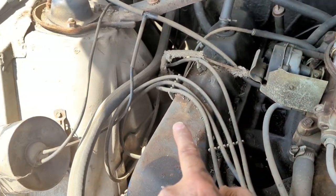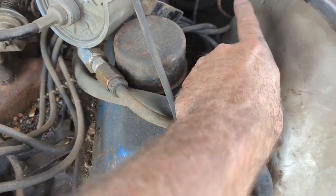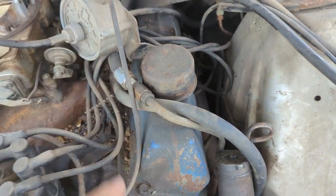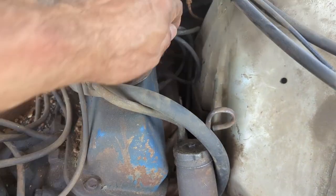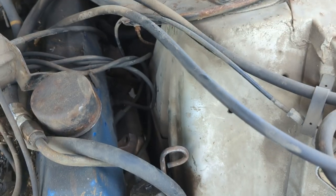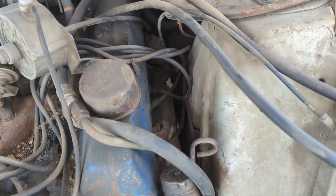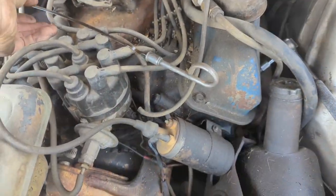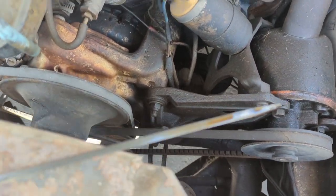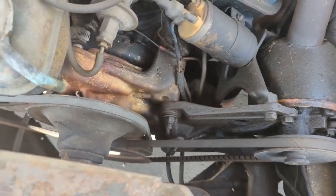I've got the right side out. Now I'm working on the left side, but I had to remove the cruise control actuator to get at the plugs - it's just tight if you don't. Just five-sixteenths head bolts, and off they come. Pretty easy. I've got the plugs mostly out. I wanted to check the oil. Oil looks good, smells good. It's fairly clean actually, but it's been sitting a while so it made a sediment.